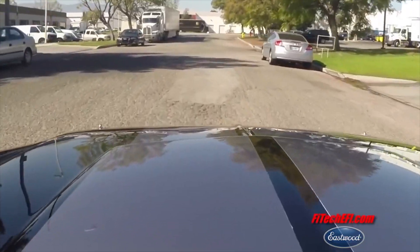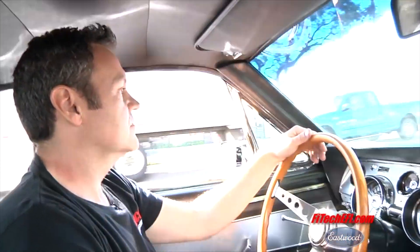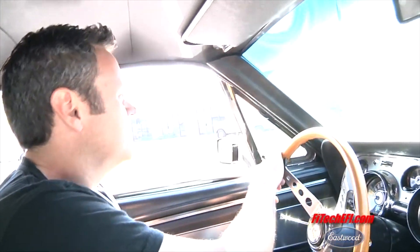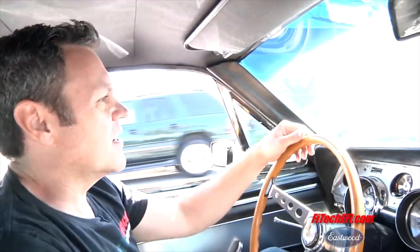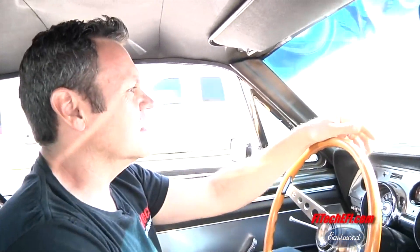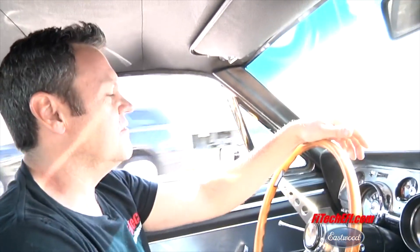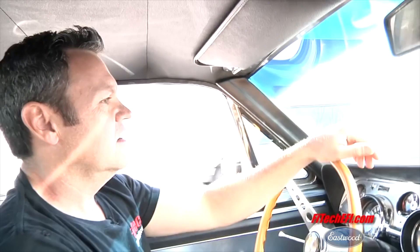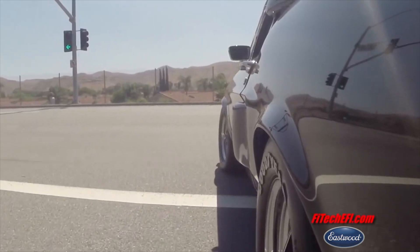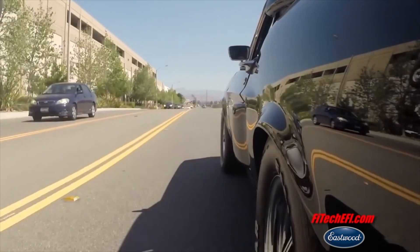You can see the car drives just like a baby — it pulls really clean. It's not what you'd expect from a motor this size. It's 526 cubic inches, all aluminum. I would have thought with a big cam like this it would need to idle up above a thousand RPM, but with the EFI on it, it just idles nice and low and you can really hear the cam lump. It comes right back down to idle nice and smooth, but this thing just pulls like a train.